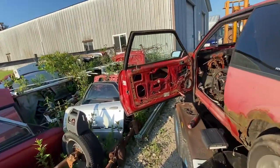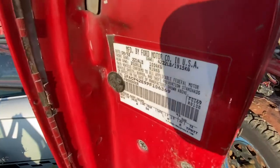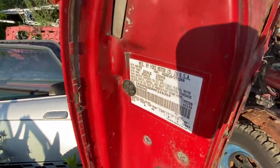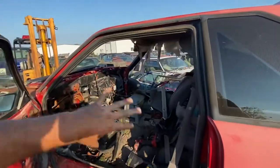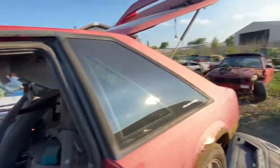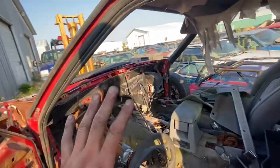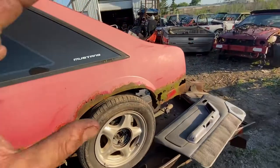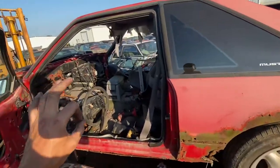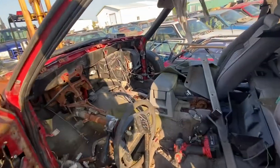This is the car I showed you the other day that was in my backyard that I had to dig out. I'll show you the production date here — 8 of 92, so it is a 93. It's got all the 93-specific goodies with it, and even that dash harness over there has the 93-only part number on it. The car I bought running, driving, and rusted, so there was not an issue with the car electronically — that's why I wanted to pull this harness. I knew it wasn't in good unmolested shape but was in good functional condition.